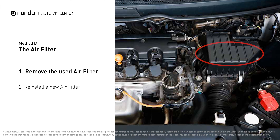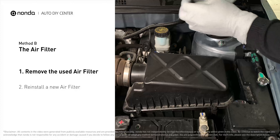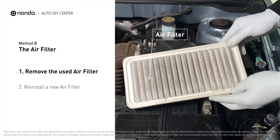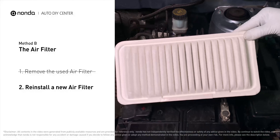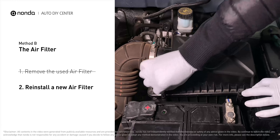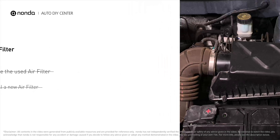Method B: the air filter. Look at the air filter housing — it usually looks like a black plastic box. Disengage the cover to expose the air filter, being careful not to dislodge any hoses or stretch any wiring. Remove the old filter carefully, paying attention to the orientation of the filter as it comes out of the housing. Clean out any excess dirt or debris inside the compartment before installing the new filter. Follow the orientation of the removed filter and put the new filter in place. Make sure the outer seal is seated properly before closing the cover, then replace the clips and screws.